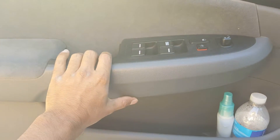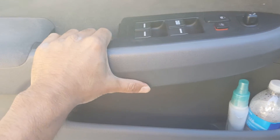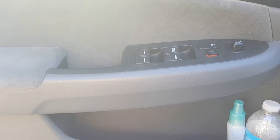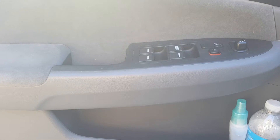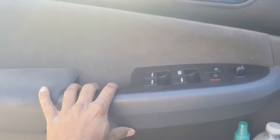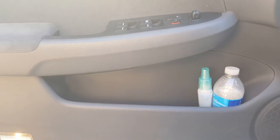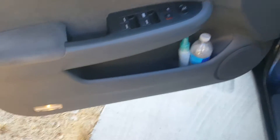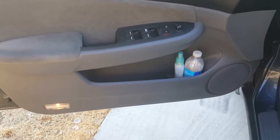Because all doors — when you pull on this door to open and close — there's got to be something that physically ties it back to the frame. Otherwise this door handle will always come off. So in general on most cars, you have two or three bolts: one always here, one generally in here, and there may be others. Just do a quick check online. So we're going to remove these two bolts.